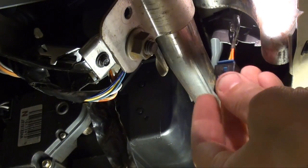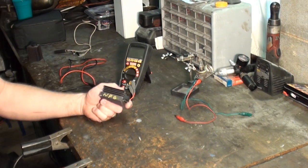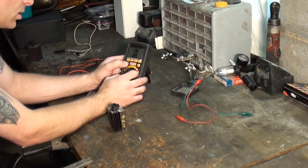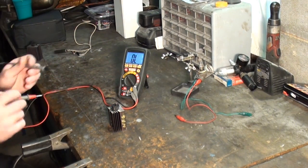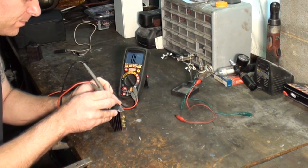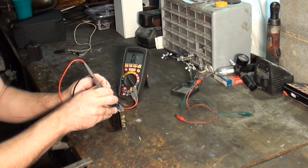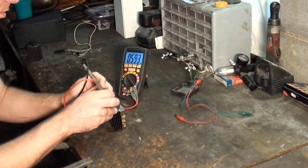So I'm going to see if I can locate the diode and we'll take it from there. I got you guys over here at my bench — I'm going to try to do a couple of bench tests on this diode. As you can see, I got this one we just pulled out, I got it labeled NFG — I'll let you figure out what that stands for. First test, I'm just going to put it on a diode check. It's just a one-way check valve looking deal there. And if you remember in my previous videos, a diode only lets current flow in one direction. Let's see what we got: 0.593. Let me reverse my leads — it's not flowing in that direction.